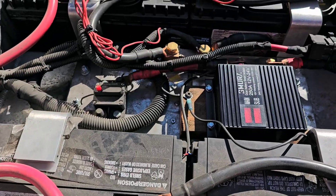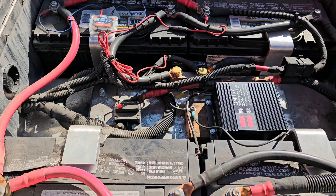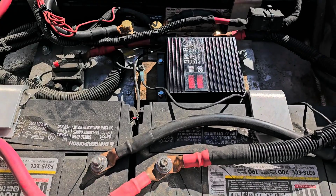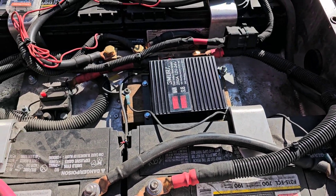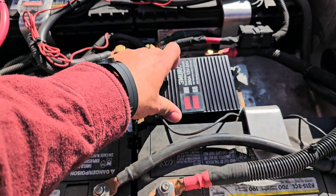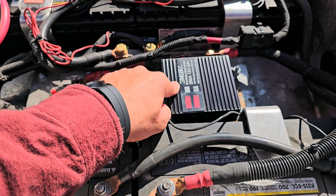Like a starting battery setup, we increase our amps — 12 volts each — just increase the amps. Positive to positive, negative to negative. I use a battery isolator; this isolator separates my starting battery from these.